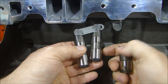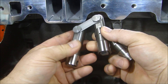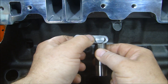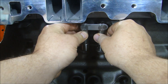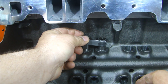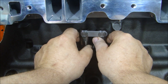That's due to the roller on the bottom, and you need a link bar. The reason you need a link bar is that this roller has to stay in the same position — you don't want these lifters rotating, because if this is riding on the cam lobe and it turns, it will make a bunch of scrap metal. Sometimes instead of a link bar, there's a piece of metal called a dog bone that holds them from rotating, and a piece called a spider that gets bolted in to hold the link bar down.